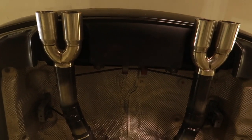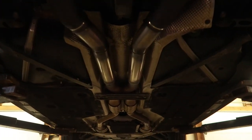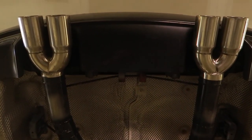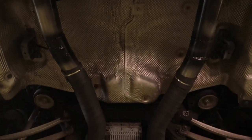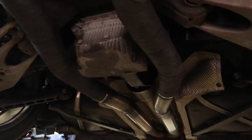This is what we're working with right now. Three inch pipe all the way down to where the resonators used to be. So we got a muffler delete and a resonator delete, and then I got these nice three inch tips on here. And then I went ahead and heat wrapped this section of the exhaust so that I don't have any issues with the exhaust melting some of my CV axle boots.